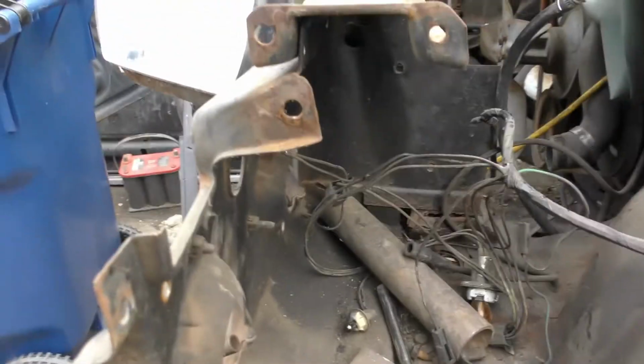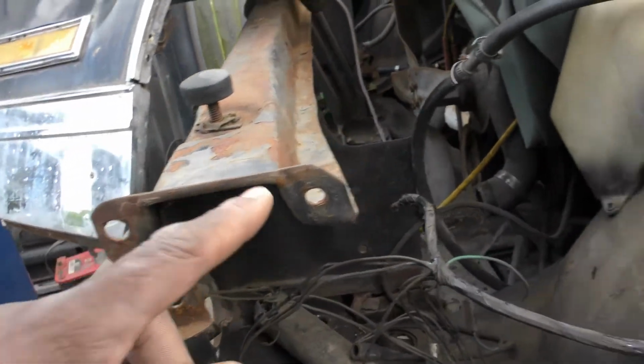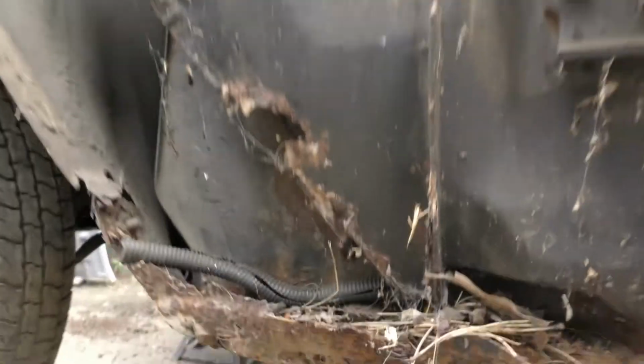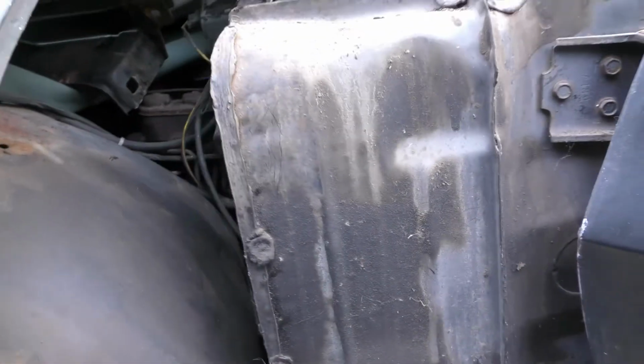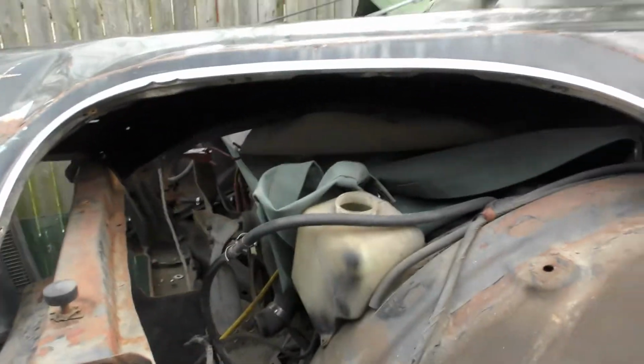to get these fenders off these Wildcats, Electras, probably all of the same. All of them about the same. You got 2 bolts here, you got 1 bolt here, you got 2 here, you got I think 5 or 4 in the middle here, and then all of these on the outside. Alright, and then you got one right here, and then it would be one down here, but that was all rusted loose. The fender is all rusted loose, guys. This is going to be a major project, a major build, guys, but whew, a lot more to go.